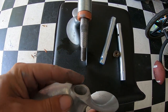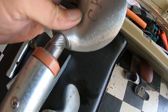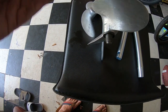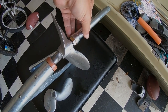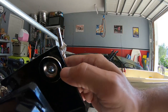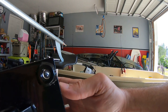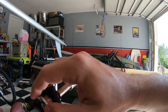Slide the propeller onto the tapered shaft — the threads will grip it. Push it on as far as you can, then put the lock washer on behind it. Put some anti-seize on those threads, then put the brass bolt on and use the tool provided to tighten it down. You can see the pads there — there are nuts behind them so after you get it on the boat you can tighten those down. Those holes are where you use your Phillips head screwdriver to go through and tighten the screws into the wing nuts.